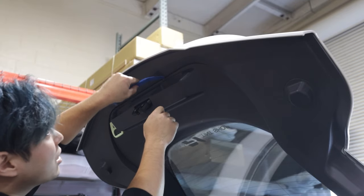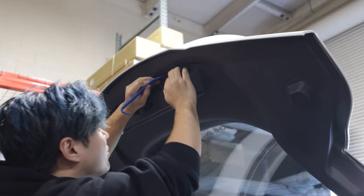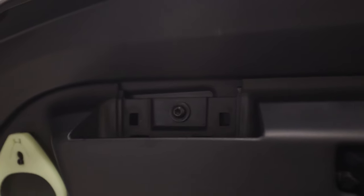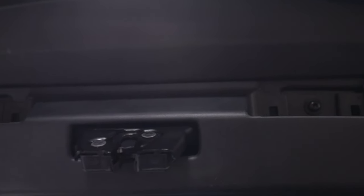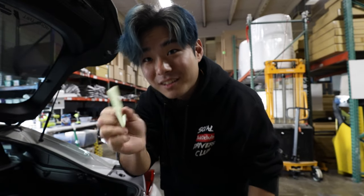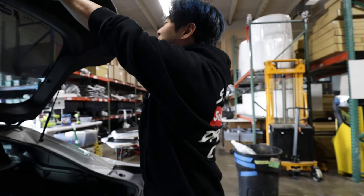Just take a trim pull and slip it under the cover. So you got these things off and those are the Phillips screws you need to take off. Oh, actually it's a Torx — wait, yours is different. Yours is a 2022? Oh, that's different, they changed it. On my 2020 you'll have Phillips heads, but on the 2022 it's Torx. So we got the child safety amber alert thing off, and now we can just pull this whole cover off.